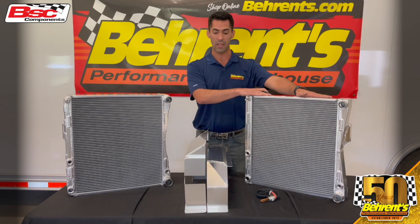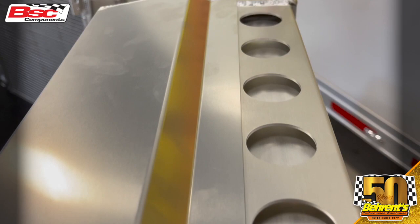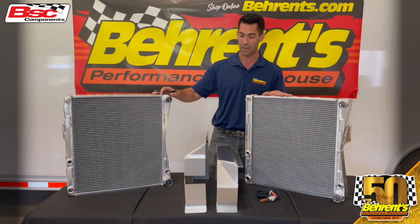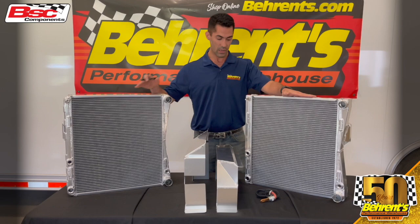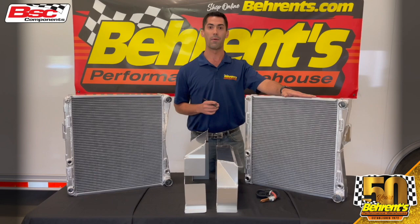With the addition of our lightweight radiator, we've made a couple modifications in regards to our fan shroud. One of the things you'll see is the top part of our shroud being flat, so that when we end up putting our hood piece on, you don't see as much interference where you have to do some modification to either the shroud or even your hood — it helps make it a little bit easier when you're putting the body back on. In addition to that, we've also notched out the lower side over here on our fan shroud so that when you end up putting any kind of a fitting here, it fits nice and snug to make sure that when your fan is spinning and in the proper setting for the radiator, you're at optimum performance.